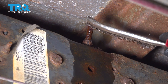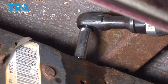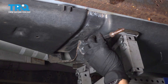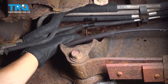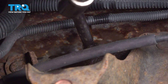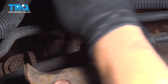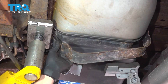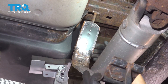I'm going to use a wire brush to clean up these threads. Once you have that mounting nut off, pull the strap down and let it swing out of the way. The rear strap is going to be right above the front side of the leaf spring. If you have rear heater and AC, you'll see the lines that kind of block it. Same 15 millimeter mounting nut — take it off the same way you did the front one. Now you can remove the rear strap, or at least swing it down and out of the way. To fully remove the strap, twist it on the back side where it goes on the frame and pull it right out through the slot. We'll do the same to the other strap.